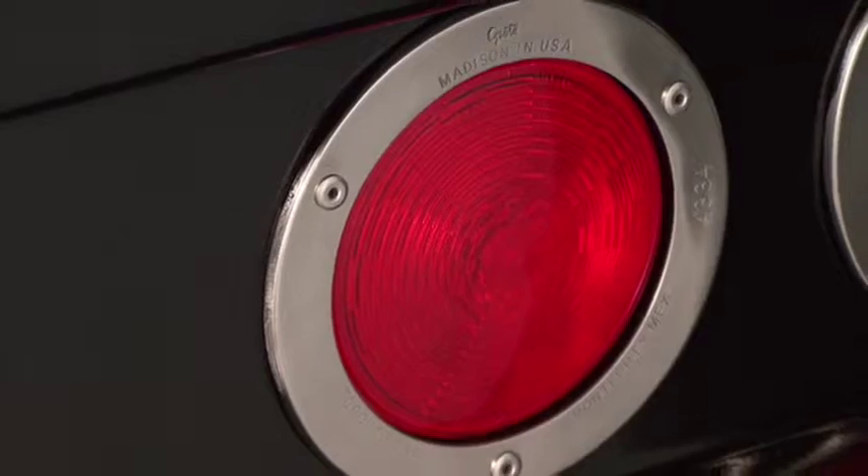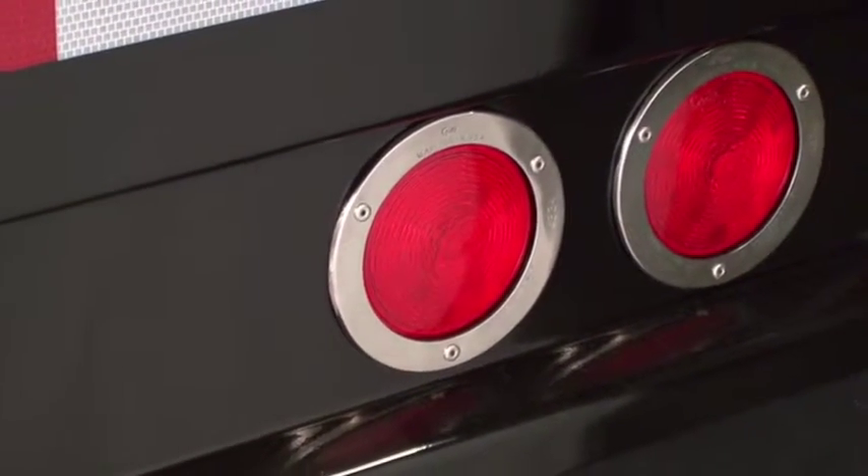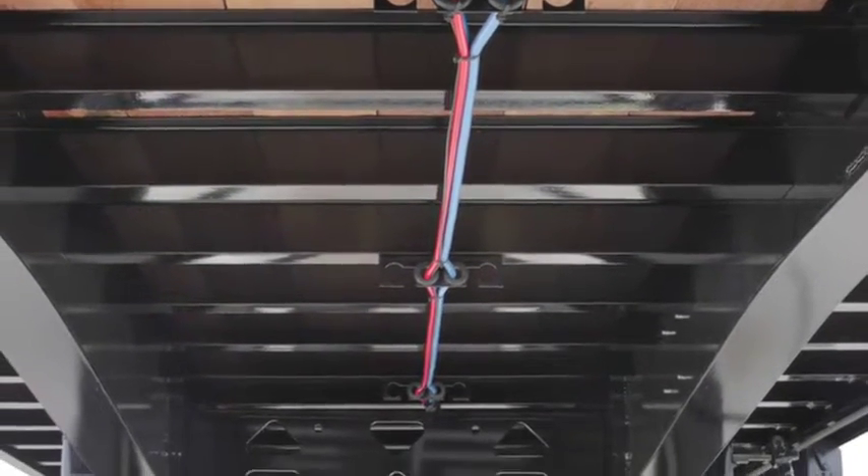The Velocity trailer comes standard with a fully sealed modular wiring harness and LED lights featuring a 5-year warranty. The air lines and electrical harness are left unpainted for easy identification and maintenance and are installed down the center of the trailer for easy access. Each is run individually rather than bunched together. They are easily removed and are protected by rubber grommets.